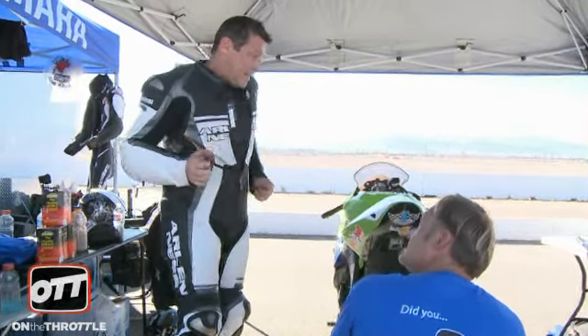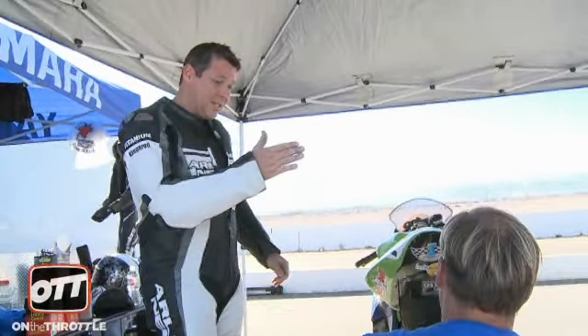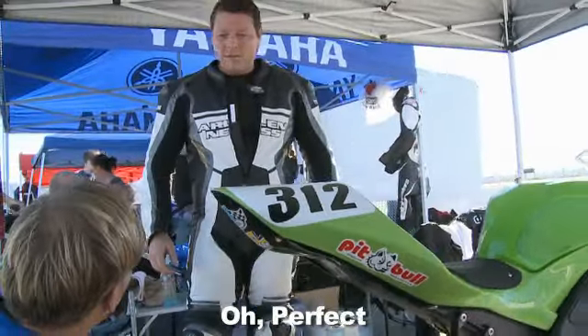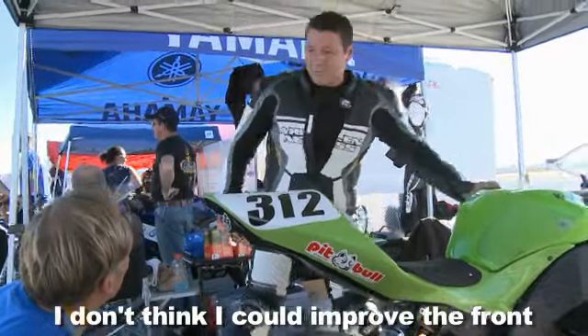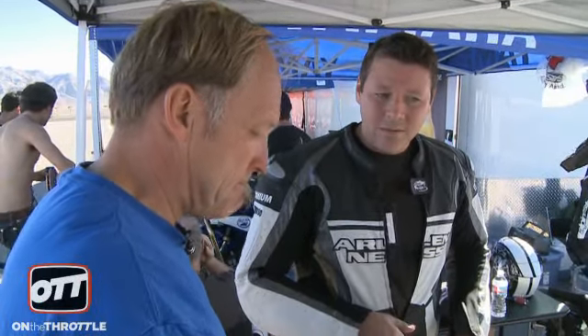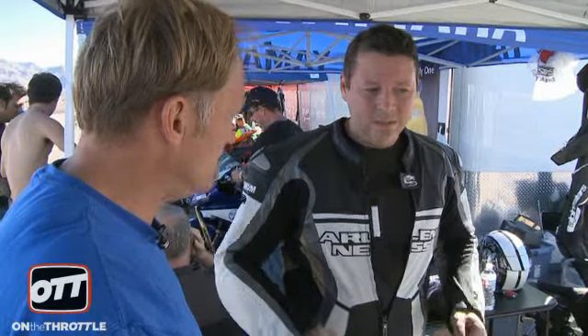It got G-loaded, so I had to get on the tank and straighten itself out right away. It didn't wiggle after that. Overall, was the bike more planted in the corners? Much more stable? I purposely over-braked in turn one to make sure it was okay, and I could go past my turning point and everything was super stable. Neutral throttle, no problems. And even after the hard braking at the end of the back straight, the pump is gone. So I'm happy with the front — we got rid of all the problems. Now we just have an enormous tire wear issue.